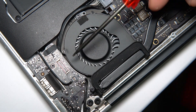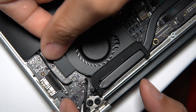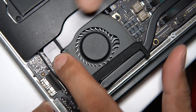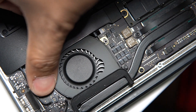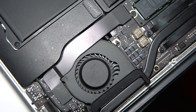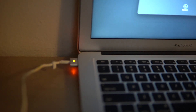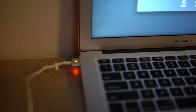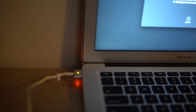Wait — one more thing. We've got this ribbon cable that we still have to put back. Got that connected on both sides. Now we should be good to go — let's connect the battery and see if this works. There you go — as you can see the charge light is coming on now, which wasn't happening before. The battery is now charging.